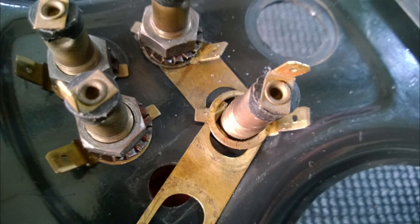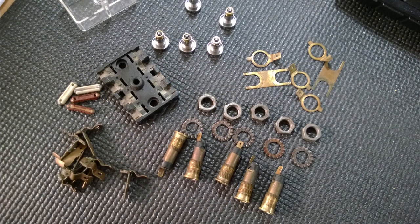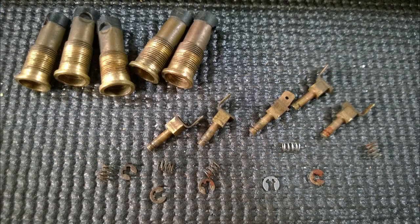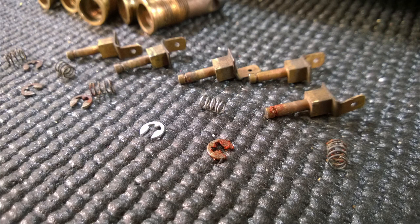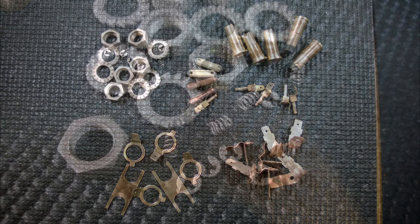Our first job was I pulled this all to pieces. There's also the fuse box, which I did at the same time. I packaged it all up and took it to an electroplater. Here we can see the rust — quite a lot of corrosion. Even though they looked quite tidy, I pulled all the pieces out, springs and everything. Here's when I got it back — I had some of it nickel plated. Circlips and all.